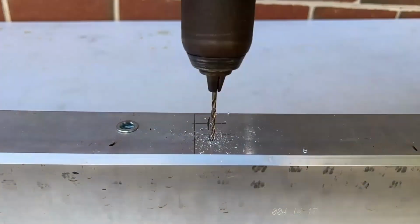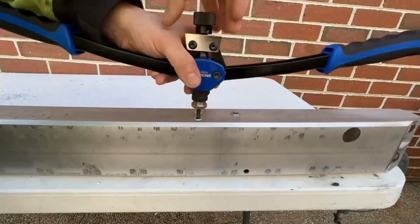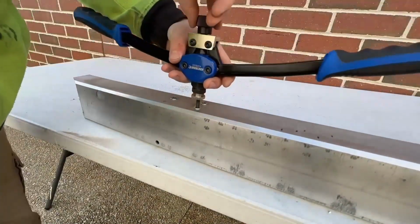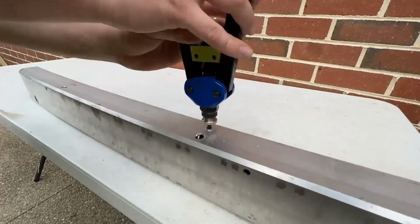The front crash bar was drilled and riv nuts fitted where the transmission and engine oil coolers will be mounted. The coolers used are Cetrab extra wide 15 row units.